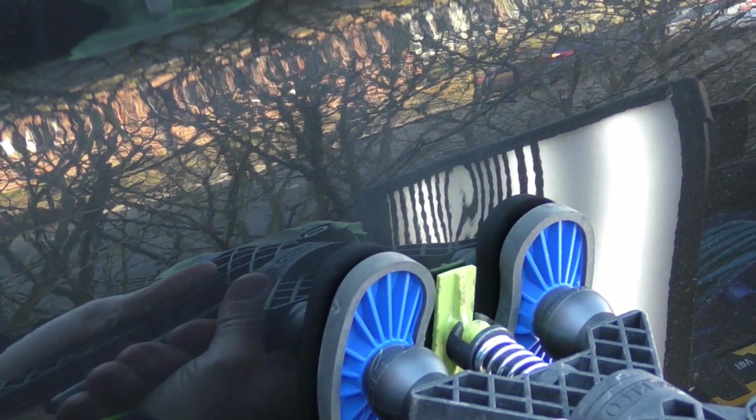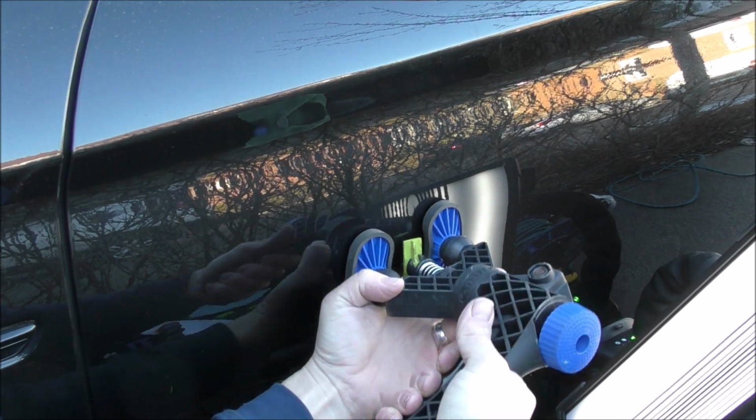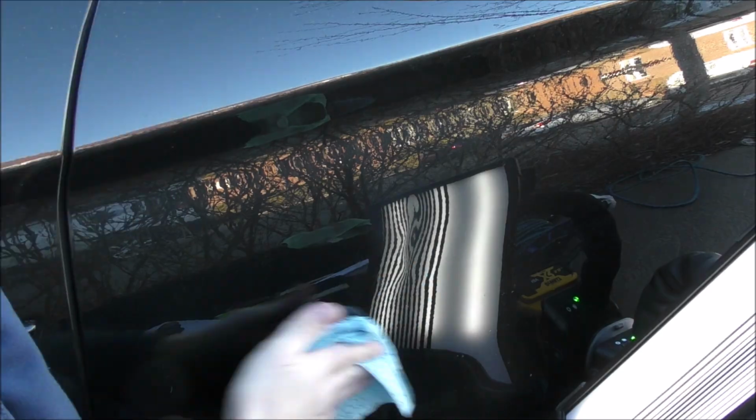Now there's a couple of times where I do pull it perhaps a little bit high, but that's part of the process for me. I like to bring the damage out, make sure I've fully lifted the lows, and then I can tidy it up with a bit of knockdown work to really level out the lines.